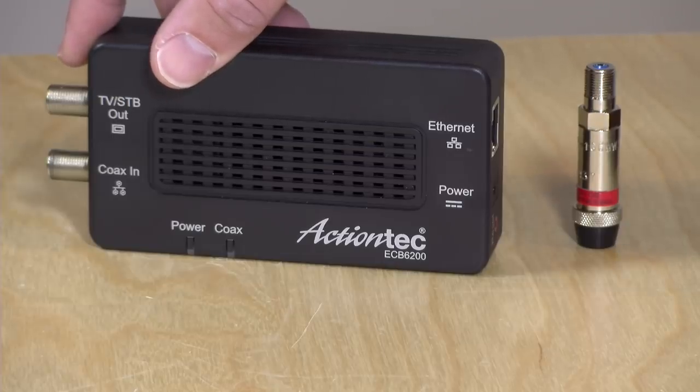Normally you need two adapters — one connected to your router and one at the far-off location — and that bridges the two over the coax network. But some people might already have MoCA built in, because some cable operators build MoCA into their existing routers. Some cable modems on the market have a MoCA device already built in, so you'd only need one adapter elsewhere in the network. Consumers should contact their operator to ask if their cable modem has MoCA built in.